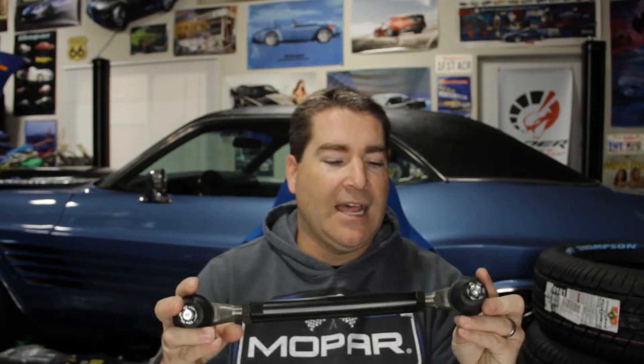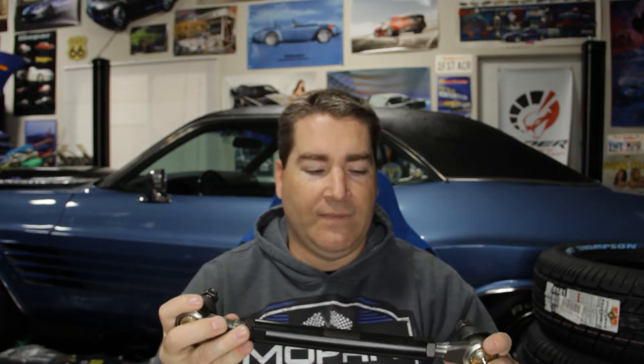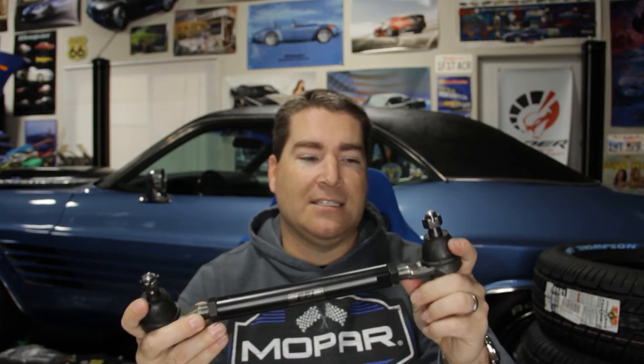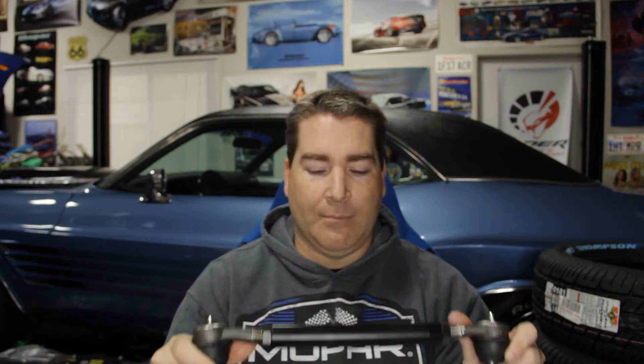I also ordered from Firmfeel new steering rods with tie rod ends and their seamless tubed bars. The factory ones are split up the middle with clamps on the ends and are a little flimsy, so this is a lot more rigid and will give better steering feel. The factory tie rods were 9/16 inch diameter; Firmfeel offers both 9/16 and the larger 11/16 inch. Going with the 11/16 gives additional strength in the steering and better responsiveness. They use all Moog tie rod ends — very high quality components.